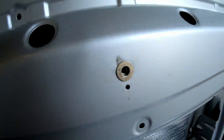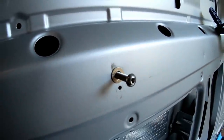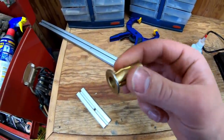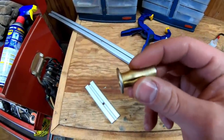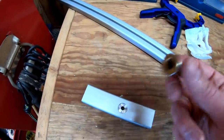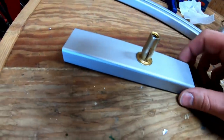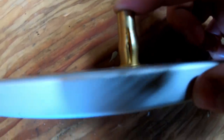We've got our first plus nut installed — now we can screw any of our 5/16-18 bolts in there and mount stuff to the walls. Beam numero uno is fully installed. The plus nuts had a slight part that stuck out of the van, and I needed to make up for that in order not to have too much tension up and down on the plus nuts themselves. What I'm going to do to compensate is drill a recess into the back of the holes that mount to the van, so the front of the plus nut can sit flush and it will be perfectly level.